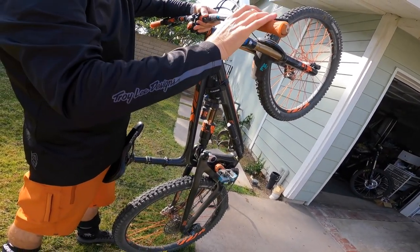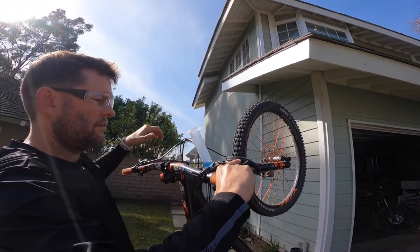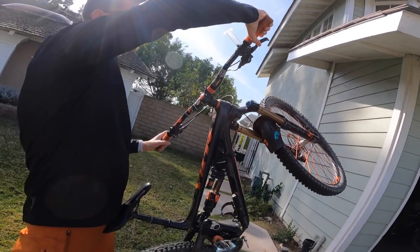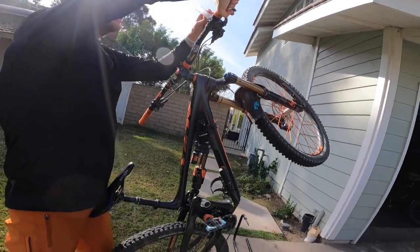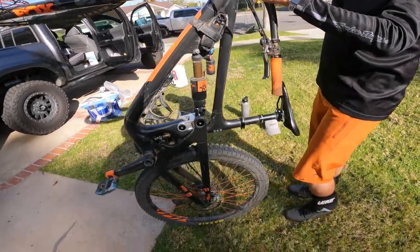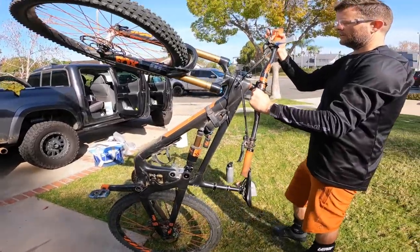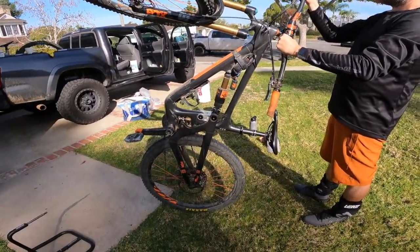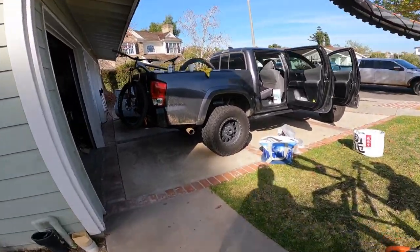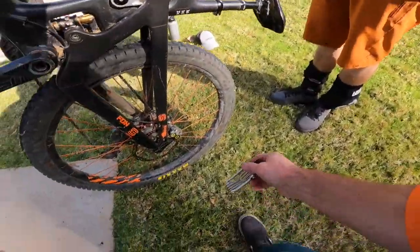You can also loosen the shifter so you can keep this whole system level. Make sure that the oil level is always above the hole so that no air can get back down in the hole. So if you look at the back hydraulic line, I'm going to keep tilting the bike back until the brake is the lowest point. Then tap the caliper — take something like a tool and tap the rotor or caliper gently and you'll get any air out of the caliper.